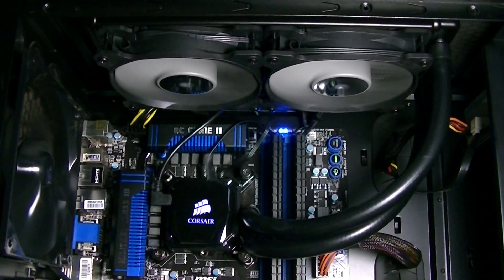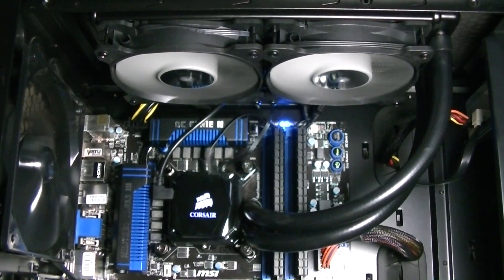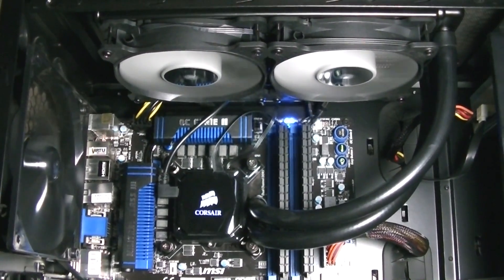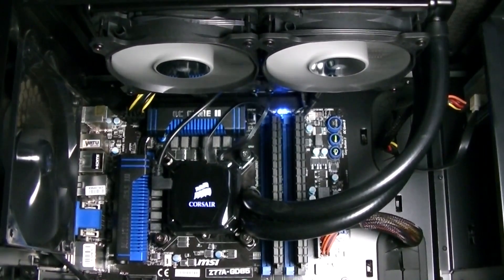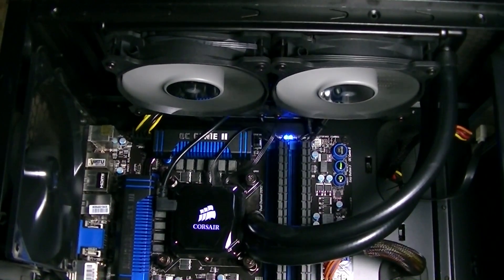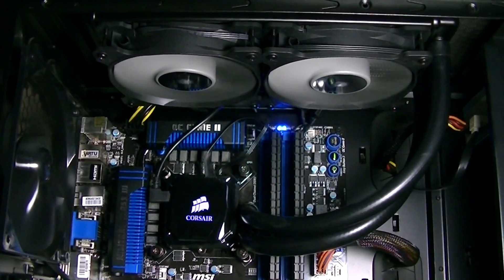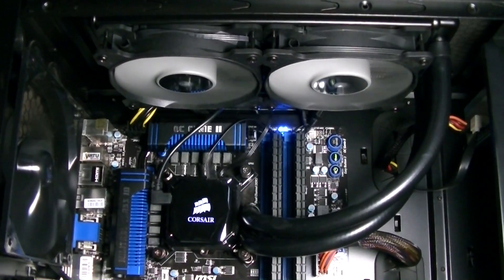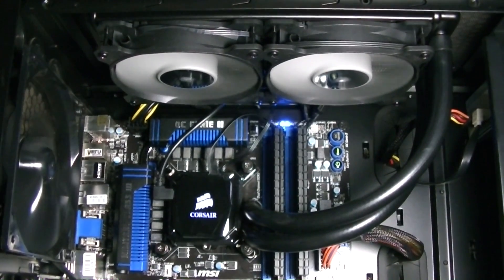Let's start with the mounting bracket — the Intel backplate to be specific. The backplate that comes with this water cooler doesn't work. There's simply too much spacing between the motherboard and the four standoffs. It will move around and is completely insecure. Please do not use this backplate as the cooler will not make real contact with the CPU, causing the CPU to overheat. This is probably an issue with the first models of these H100i units. Corsair will probably fix this sometime soon — it looks like they made a measuring mistake. What I did to solve the problem was use the Intel backplate from my older Corsair H100, which is working perfectly fine. But if you don't have a spare backplate from the H100, you could use non-metal safety washers.